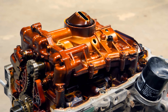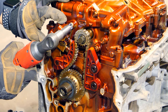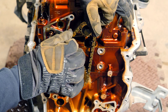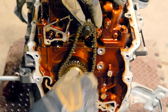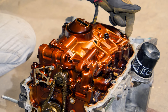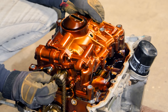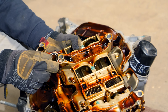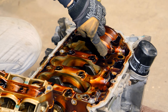Next, pull off the massive oil pump. The oil pump chain tensioner needs to be removed just like the timing chain tensioner. With the male tensioner bolts and female guide bolts removed, there isn't enough slack to take the chain off — the pump has to come off first. There are five bolts holding the pump to the block. With them off, angle the pump downward to give enough room to slide the chain off. Also remove the o-ring that seals pressurized oil to the engine — it will either come off with the pump or stay on the block.